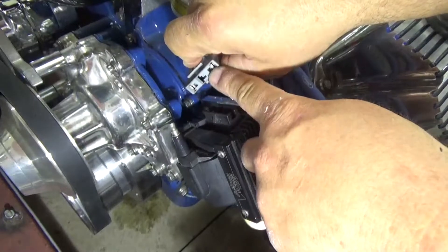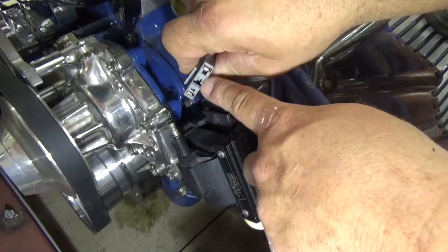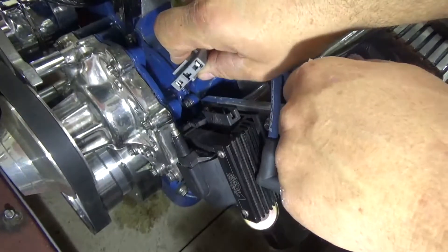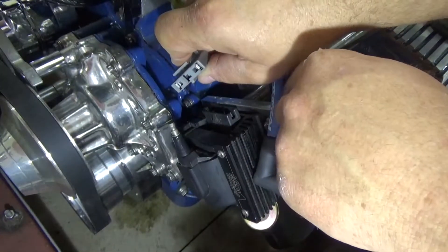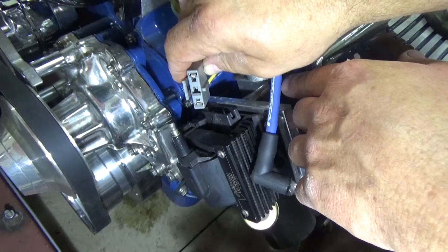Since this is fuel injected, there won't be 12 volts coming here because it's controlled by a microprocessor. So I'm going to pull out the processor and look for an error code — it's mounted in the passenger compartment. Now, this is going to be a pretty easy one to solve. I opened up the dashboard and looked at the spark control module under the dash. The fuse was not blown — it's only a 10-amp fuse — but as soon as I took the dashboard off, I could smell that burnt electronic smell. So I'm going to open this up and take a quick look inside.